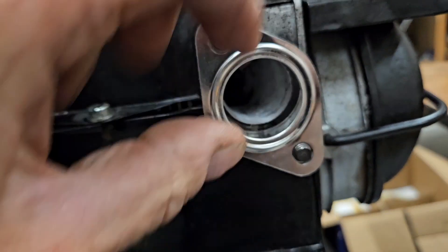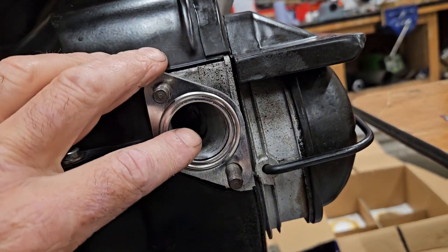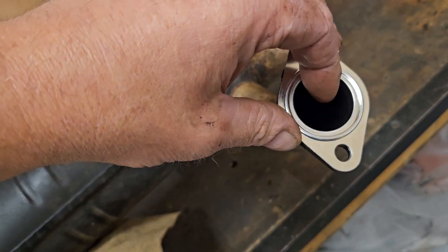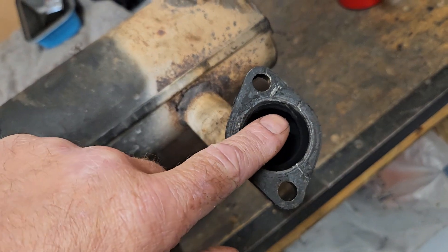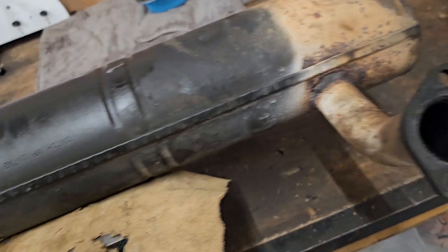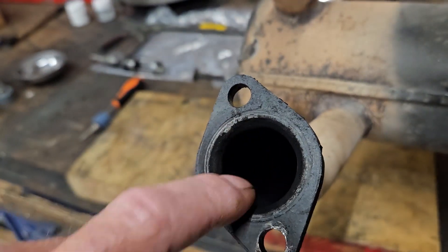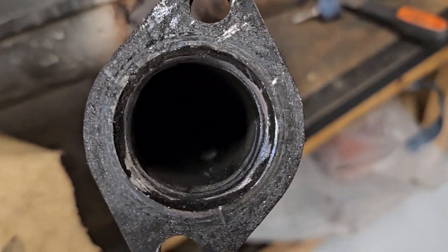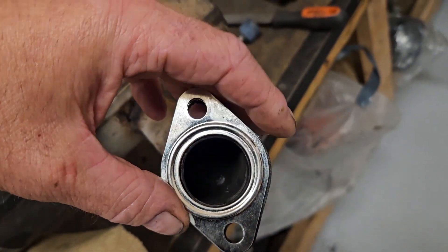Before fitting the exhaust, I'm double-checking that the gaskets are matched — I did quite a bit of cleaning up on the exhaust port and matched it to the gasket, but I also want to check it's matched to the actual exhaust itself. Here's the exhaust with the gasket on it. It's quite carboned up but there's a weld that goes all the way around that's quite proud and in the way, so I'm going to clean that up on both sides — not remove it completely where it's welded, but remove the unnecessary lump to make a much nicer flow on the exit. You can see the material I've taken away from that lumpy weld, giving us a matched gasket to exhaust port.